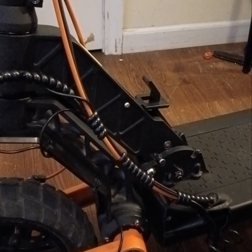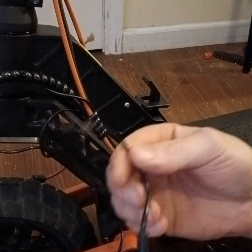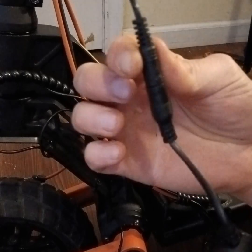Make sure it's a 12 volt and not higher. If it's 6 or 12 volt LEDs it will work for your scooter. If it's higher than 12 volts it will not work — just going to remind you guys of that. Once that's all said and done, you take this part, it plugs right in.